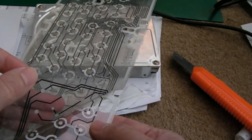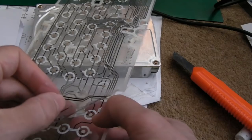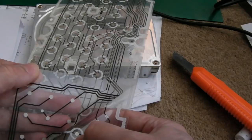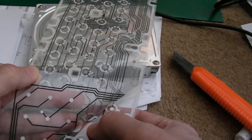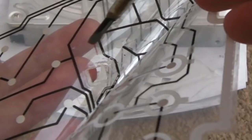Just a little bit. And if you do touch this, try stay away from anything with the connections on it, because any kind of mark, rub, pressure, you know, I nearly touched that black bit there then, could create more problems. Slowly, slowly. We're getting to the area now, aren't we? It's just here where my thumb is. Yeah, there we go. You can see little black bits coming off, look. Right, there's the damage. Can you see it? Where the screwdriver is, the ink has worn away on this whole stretch here.